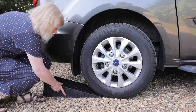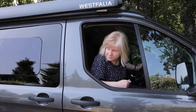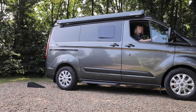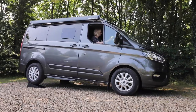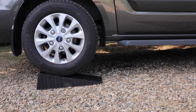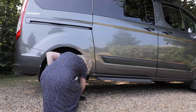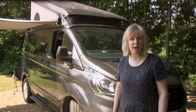Now make sure everyone steps away from the vehicle — this is one of the vital safety points both for you and your motorhome. Never let anyone hold the ramps when a motorhome is driving to or on them, just in case it lurches unexpectedly. Don't be tempted to stack ramps or put them on bricks or other blocks unless they're designed to be used like that, and don't drive off the edge or the high end of the ramp.